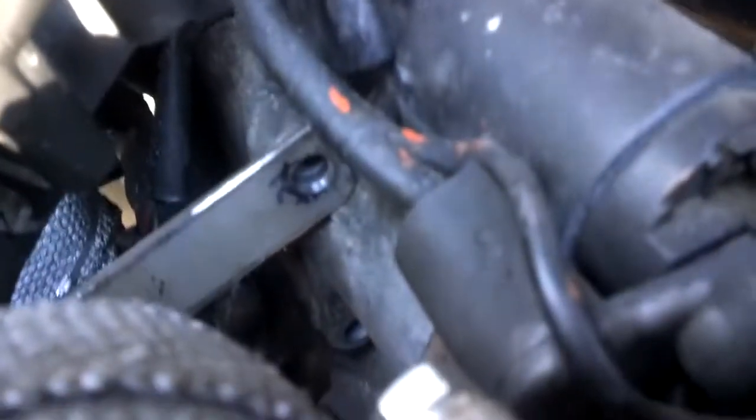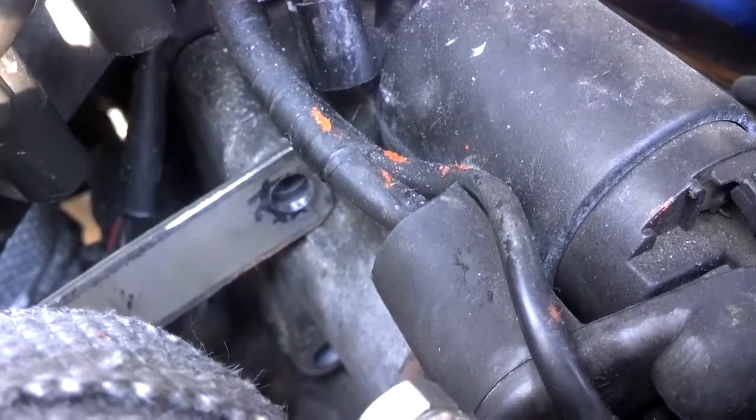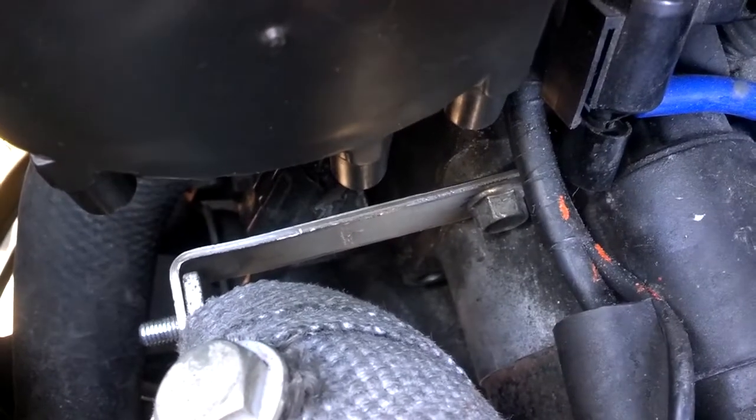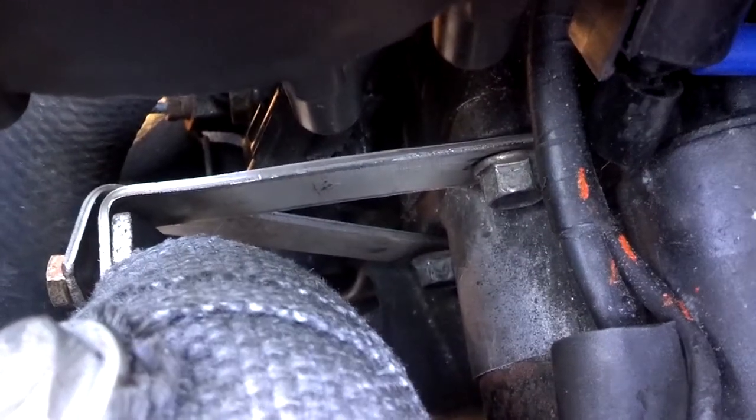You can see I put the bolt through and that slides on there. The hole lines up perfectly with that starter hole. There's the top turbo bracket bolted in. I've got the top and the bottom in place. That bolt is not fully tightened right there, but when it is it should pull everything tight. I'm going to take these out and paint them so they don't rust, since this is just mild steel — but basically, that's the turbo support bracket.